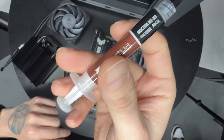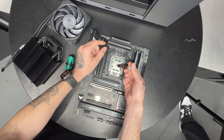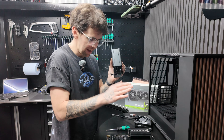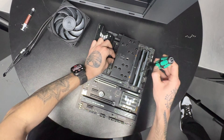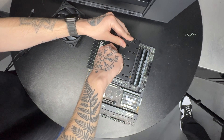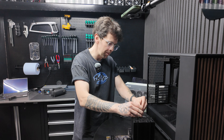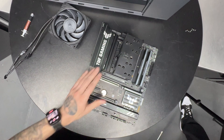If you have two pieces of metal touching without any way of transferring the thermal energy from the CPU to the cooler, you're going to have a very bad time — and chances are your house may smell like burnt metal for a little bit. That is where thermal paste comes in. The general advice is just to apply a pea-sized amount right in the middle. The contact between the cooler and the CPU will spread it out anyway. Once you've lined it up, screw it in.